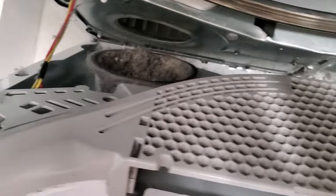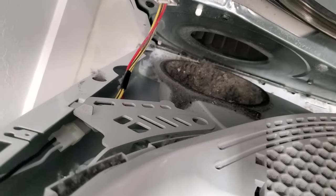I've also got a stretchy vent on this thing, which is a no-no. Since we just bought the house, I've got to put a hard vent in instead of that inchworm vent.